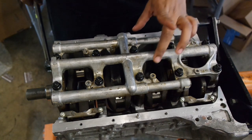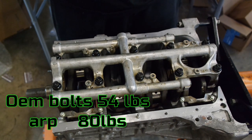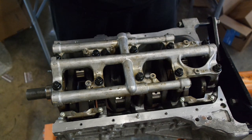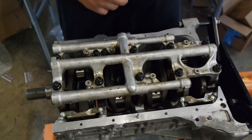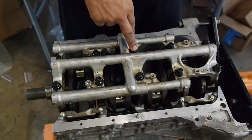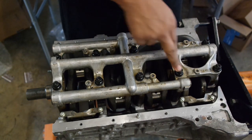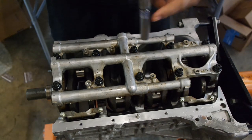From what I've read, the main studs are to be torqued to 54 foot-pounds of torque — if I'm wrong, I'll throw the correction right here. I have my torque wrench set to 30 because I'm going to do it in two steps: 30 first, then reset to 54. Now keep in mind, it's kind of like when you put your lugs on — you always start in the middle and do an X pattern. So I'll do the first two center ones, then go in an X pattern out from there. That's the torque sequence.